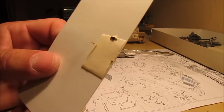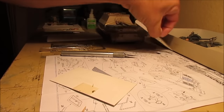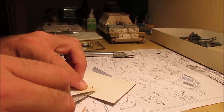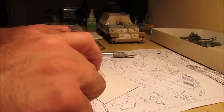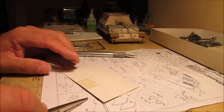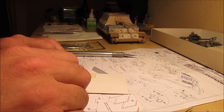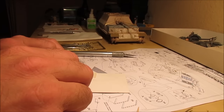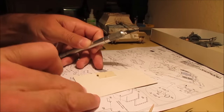You see that? Two blades. That's all it takes, guys. Now, get your serrated needle nose, grab the part, pull up gently because the tape is really strong, and make sure that the tape is nice and flat. Now you have something to grab it from. Grab the part, trim it, put the demarcation line right outside of the tape, as you can see right here. Beautiful, beautiful, beautiful. Really beautiful.